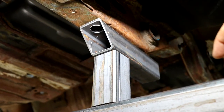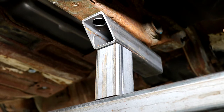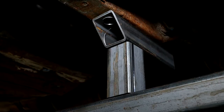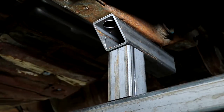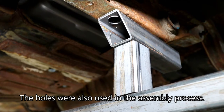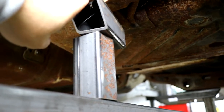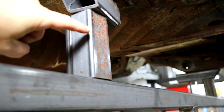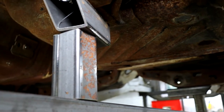Here's a little update on how things are going. Right now this is just in its mock-up phase, but you can see we are on the main crossbar — that's where the torsion bars go through. We have a little round bar that will go right up into the hole here. The idea is to keep everything from shifting using the frame alignment holes, which are sometimes used to pull the car or frame back into shape after an accident. Same thing back here — we have the alignment hole lined up right here. This is just mock-up phase; the load bearing part will be right here, and that's just per design. Once we get everything welded up it'll be fine and hold its shape.